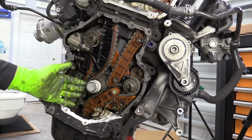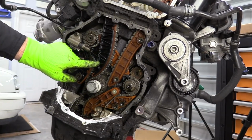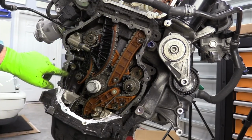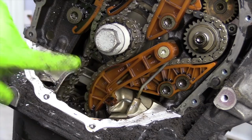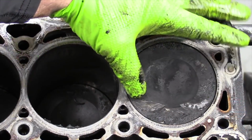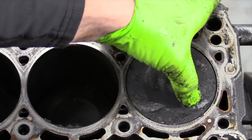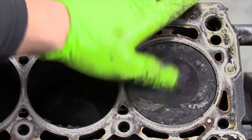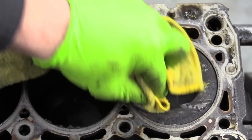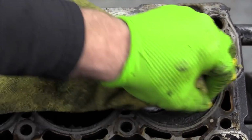First one up. Love the EA888 work you've got going. If you guys haven't seen that teardown video of the 2-liter turbo, it's pretty good. I highly recommend it. I'll be sure to link that up. My question is fairly typical. Every shop I've asked about piston replacement has said that they will have to remove the head to do it. I want to know if it's possible to do the job exclusively from the underside, or is there something I'm missing? I figure simply locking the cams and reinstalling the crank, observing the position would be enough.